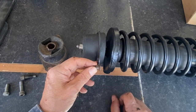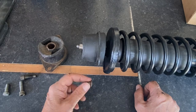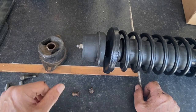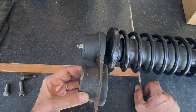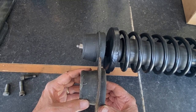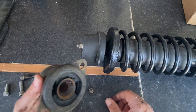There's also a question people have raised about a potential ride height issue — that these top mounts you can get now are different from the original ones, perhaps a bit wider. I've got one of my old ones off and you can see they're not actually that much different. In the comments people were talking about it being 13mm. I think this one suits this car, and maybe it's the earlier Elans that have got a problem.